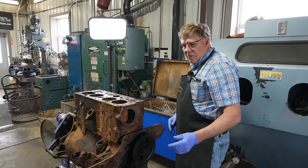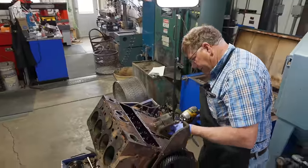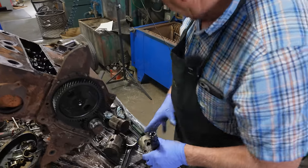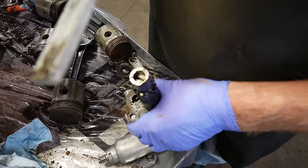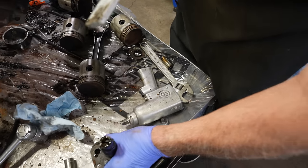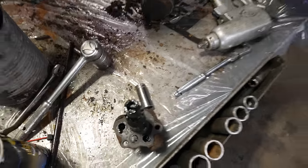Let's just keep going here. Take a few more things apart — we'll go ahead and take the oil pump off. And out comes the oil pump. Now maybe we can see that a little bit better — where that screwdriver slot is in there and it is offset to one side. So that has to go back in the right way to have everything timed correctly. We can probably find some literature on this that tells exactly how that goes. But I also want to look at how it was when we disassembled it.